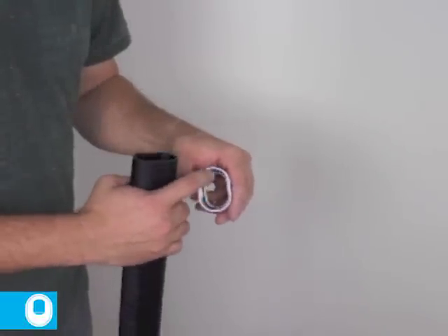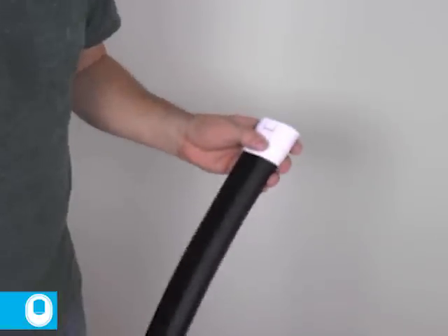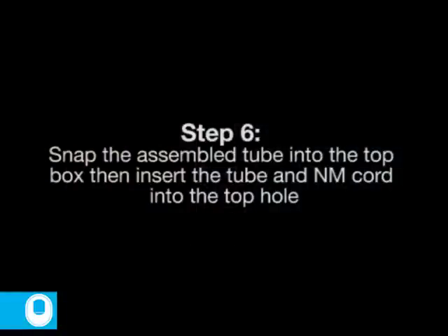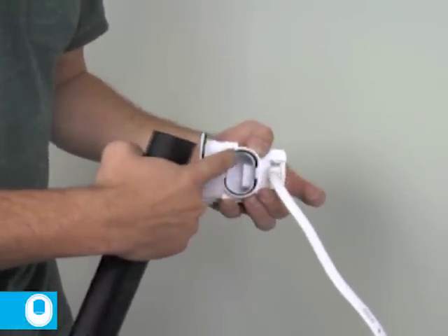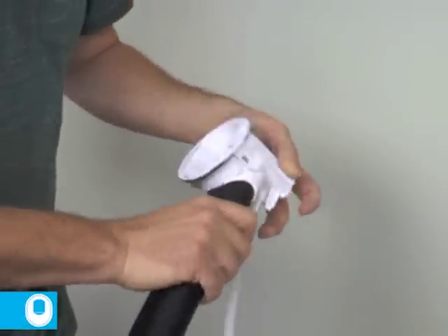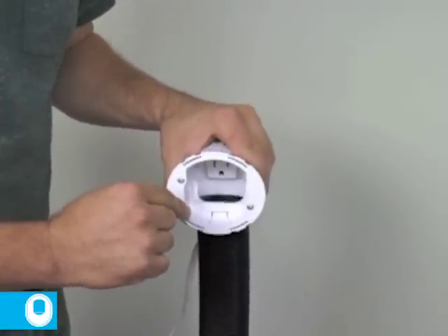Take a look at the coupler. You will notice a gasket on each side of the coupler. Make sure that the gaskets are completely seated on each side before attaching the tubes. Insert the tubes as far as possible. Notice that there are gaskets in the tube port of each box — make sure they are completely seated. Watch the sides of the port to make sure that the tube does not get stuck as you insert the tube as far as possible. Look inside the box to make sure that the tube is fully contacting the gasket and inserted as far as possible.